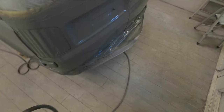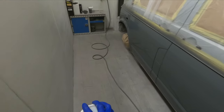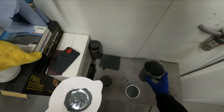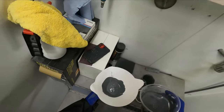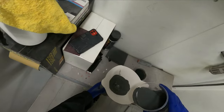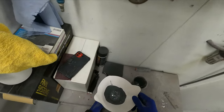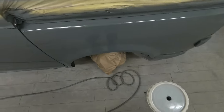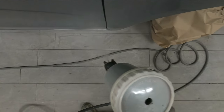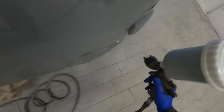So one thing you do want to make sure is, even if you just wet flattened the car, just put it in the booth and give it a bake for half an hour before you do the masking and start shooting colour down. Because everything goes into the prep — we spent probably a week, maybe ten days on this van before it ever saw the booth top coat. And as far as this goes, it was probably less than an hour's worth of actually painting. The top half will probably be less than an hour's worth of painting as well. When it comes to the bumpers and all the trims, there's probably an hour or two of painting all the little awkward bits. So there's less than a day's worth of painting for ten days of prep — so you don't want to skimp on the prep side.